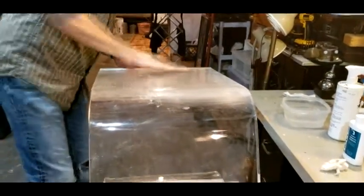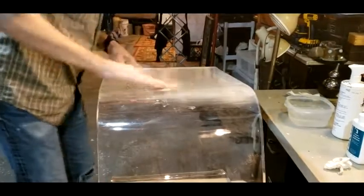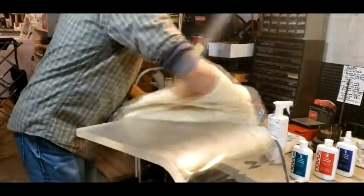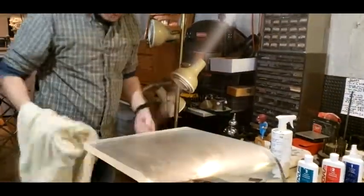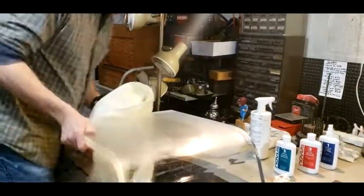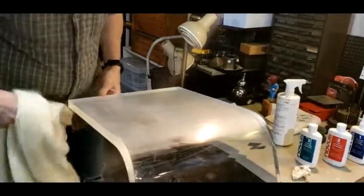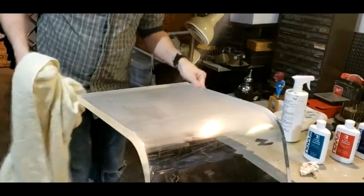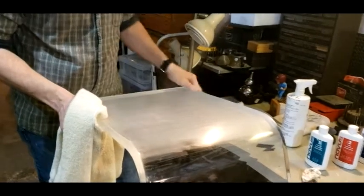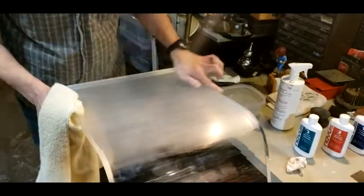So after I get done this section, I'm going to wipe this stuff off and we'll see what these scratches look like — we might have to do it again. So we wipe this off and it's going to look horrible. But what you want to see is: did you get a lot of the deep scratches off? I can see right away that there still are some deep scratches. I sanded for about close to 10 minutes — not as bad as some instructional videos where someone said they did it for four hours — that's crazy. I wanted to show you guys a different way. Some of these are really deep, so I'm going to go one more time.